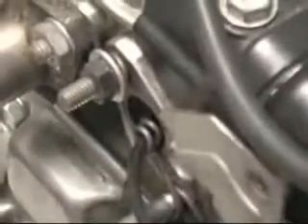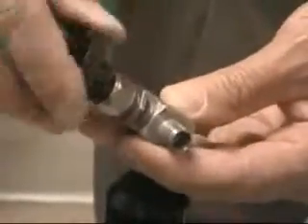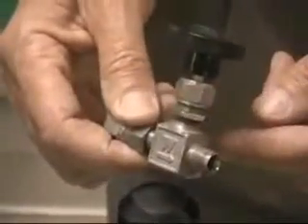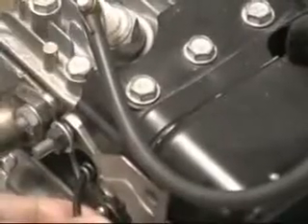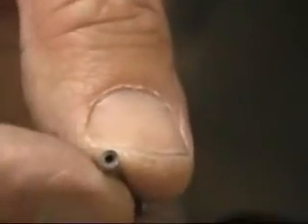We're doing the engine power control with a metering valve, which is a needle-type valve common to the instrumentation industry, where it would be used for controlling the flow of nitrogen, oxygen, or hydrogen in a lab. It's sized for delivery on an eighth-inch tube; we then cut it down to an even smaller diameter at the point of injecting — about a sixteenth inch at the entry point. We're going to zoom in on this carefully as an example of the orifice size used for delivering hydrogen at the intake port on a very inexpensive conversion.